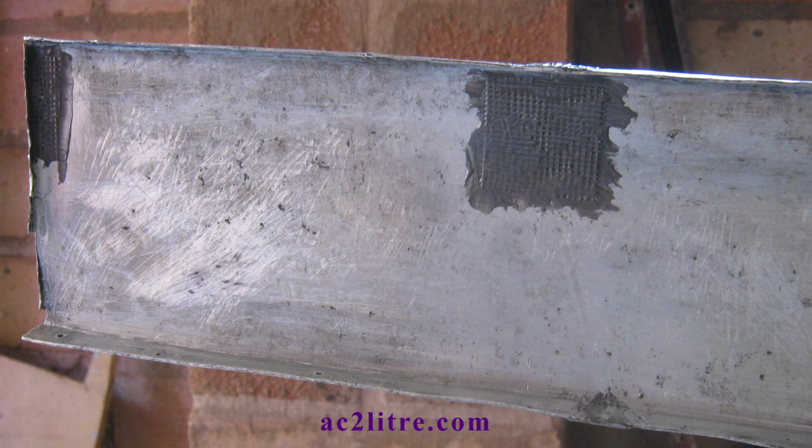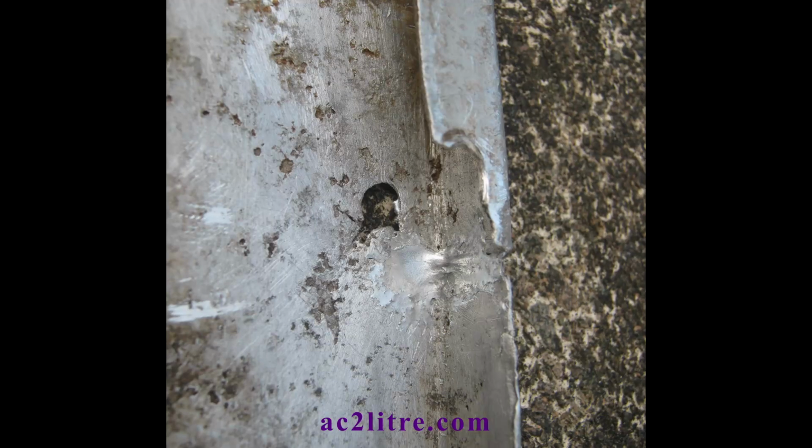Aerospace repair methods I read about included epoxy glue repairs with glass fibre patches to reinforce them. That avoids creating those heat-affected zones. I then got interested in some brazing processes developed in the USA. I bought a kit called HTS 2000. I experimented with it on a sheet of pure aluminium and it worked very well.